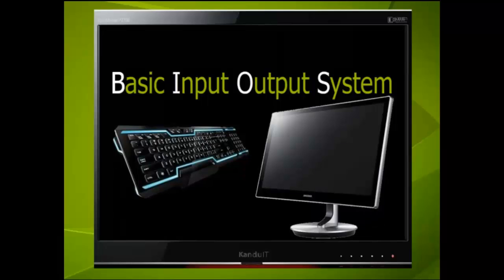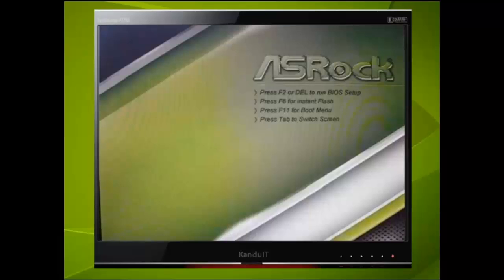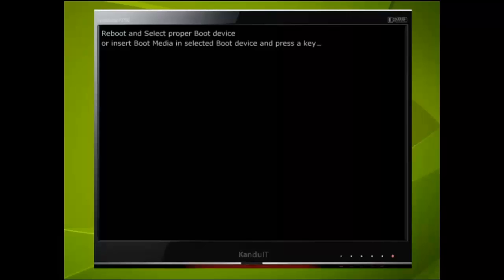Let's switch on the computer and see what messages and listen to any sounds that may appear. It has now come to a halt and prompted the user to insert boot media. But there was a message even before we reached this point, and also a single bleep. This time we shall turn the computer off, then back on. Just one point here before you go any further: switching a device like a computer off then on again very quickly can sometimes cause problems with the sensitive electronic components. Always switch off, wait a few seconds, then turn it back on.